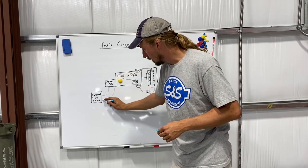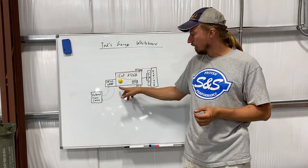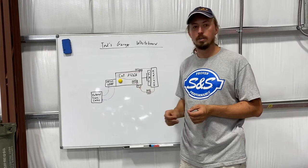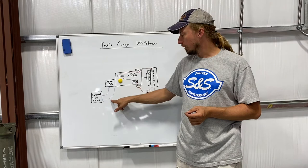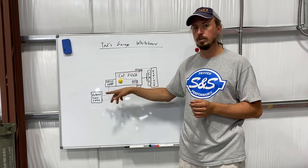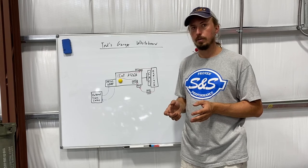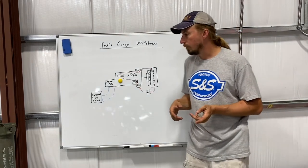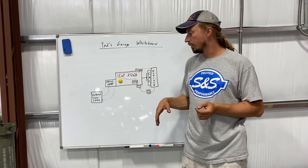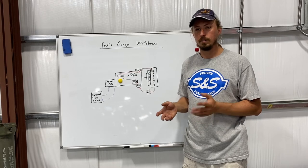The only issue I had is that my thermostatic switch is right at the entrance to the transmission coolers, and there are two problems with that. One is that all of the line running from the transmission to the cooler gets airflow going down the road, which can provide some level of cooling. The bigger issue is that the thermostatic switch has a lot of exposure to wind, so at highway speeds the fans weren't kicking on until about 203°F, when the switch is supposed to turn on at 180°F and off at 165°F. I've added some insulation and may add a manual switch as well. Either way, 203°F is not the end of the world — maybe a little warmer than I'd like but still okay for the transmission.